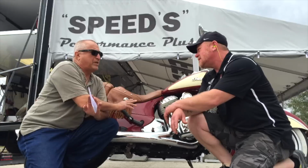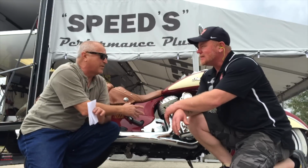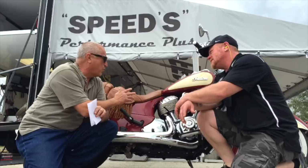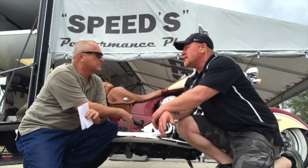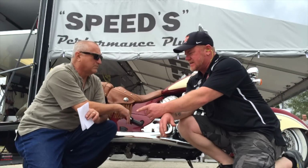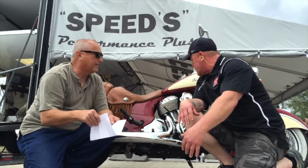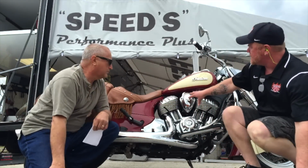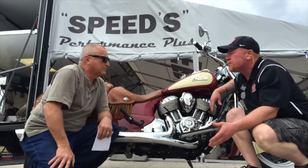All right, I'm at 71 horsepower. And I mean, really for me it's enough, but some people might want more. Yeah. What can we do just to get it up a little bit? Well, I think the bike will come in at 71, 72, 73 horse, which is normal, and like a 105, 106 foot-pounds of torque. Generally, one of the first things we do on the other side is we'll put an air box on the bike, to give it more air.